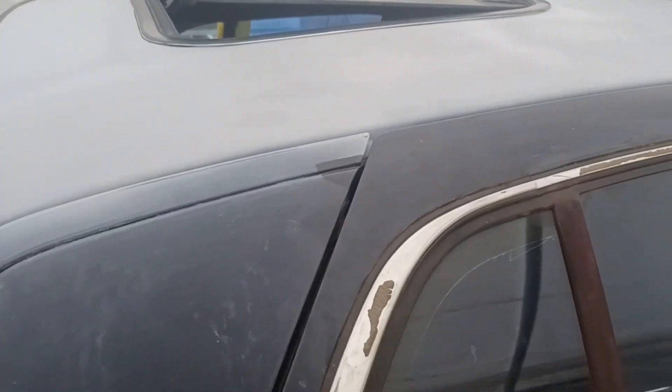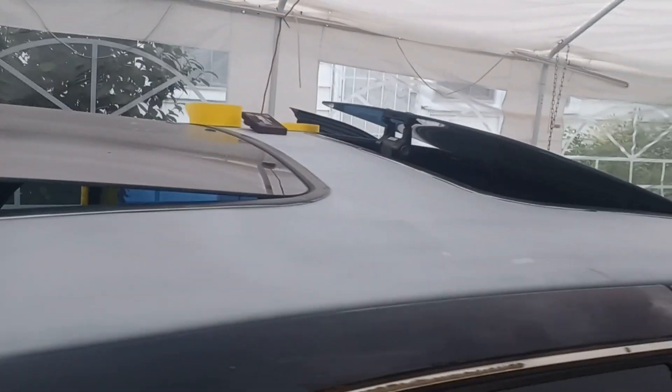I've been moving, man. I put the glasses back in there, primed it — put two coats of prime, kind of dry sanded, she's real smooth. Smooth to the touch. Dry sanded with 600. Put the glasses back in. Kind of cleaned the car a little bit, vacuumed it out. Had headrests sitting on the back seat, cleaned them up. That's really what I done did to it so far.